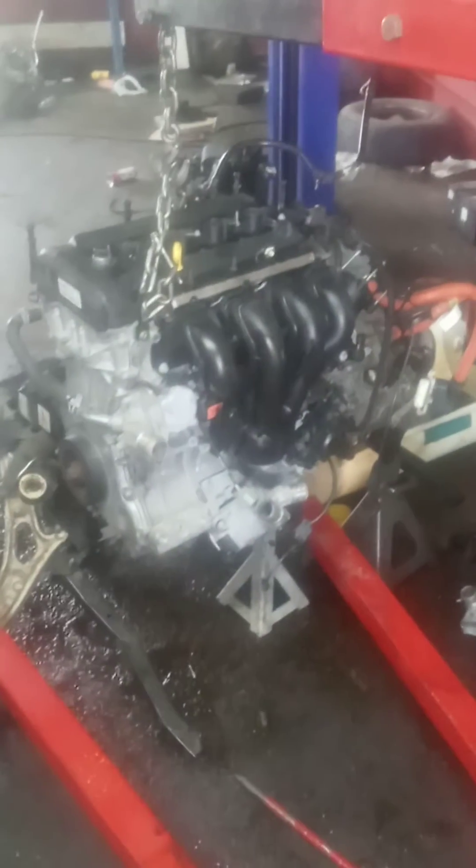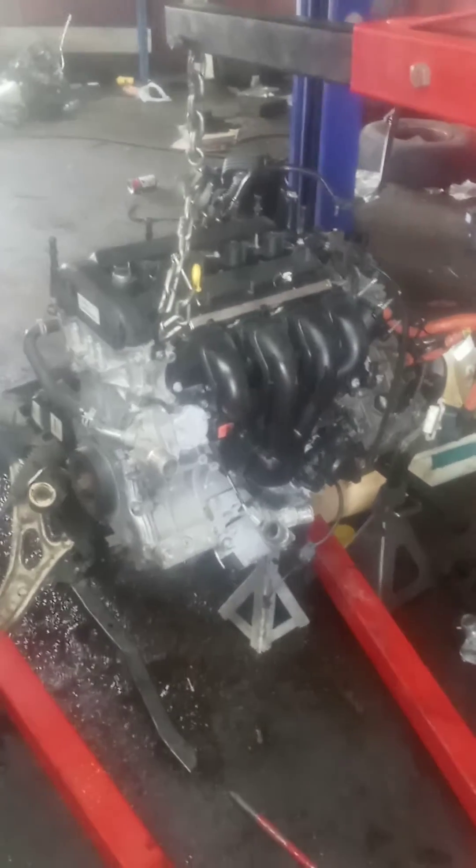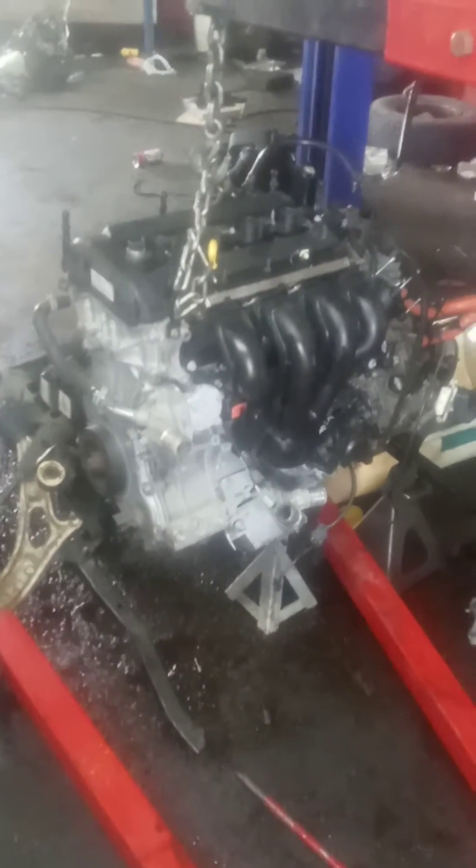Have a good day. You know about how you install the engine and transmission on a Ford C-Max Hybrid — you will have to drop the engine and transmission together as one unit, and then separate once you get out of the car. Because of these two bolts — you see you have water pump housing right here, and you have two bolts on the inside. You're not able to get to those bolts with the engine in the car, no matter what you do.